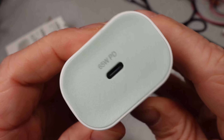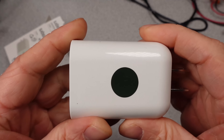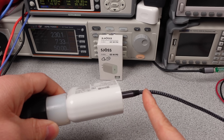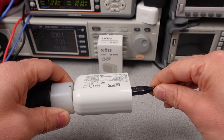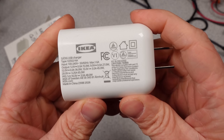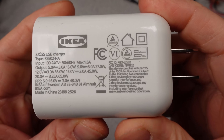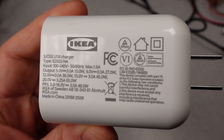Here is the adapter. It shares the same design as the other IKEA adapters in the series, but has more power available. The adapter is actually fairly fully featured, though it does have some limitations. Some initial concerns are the non-folding plugs and the fact that everything is in a line, so the adapter will stick out rather far from a regular plug — particularly problematic in certain outlet designs. This adapter has a safety listing, which is usually an indication that the device will fail more safely. It also has the 6-in-a-circle mark, indicating a certain level of efficiency and idle power usage.